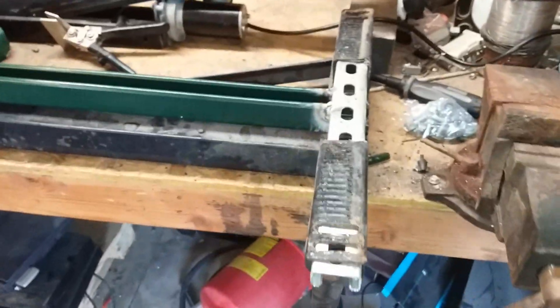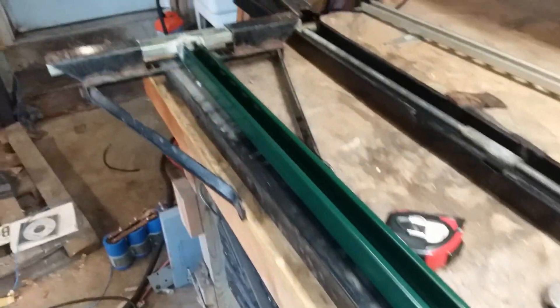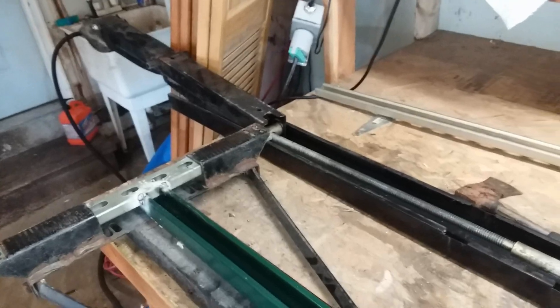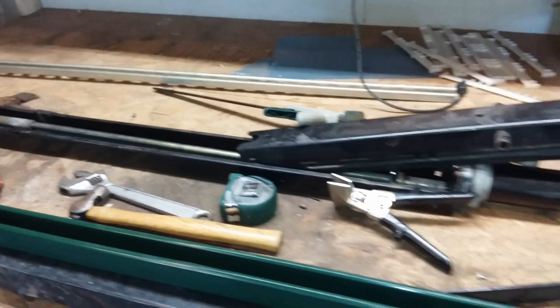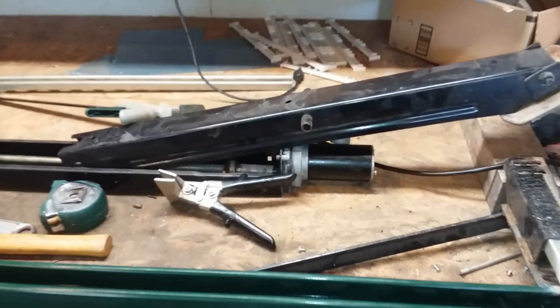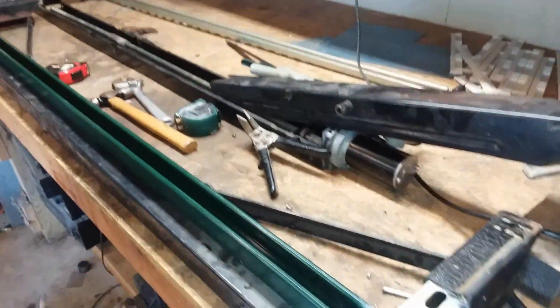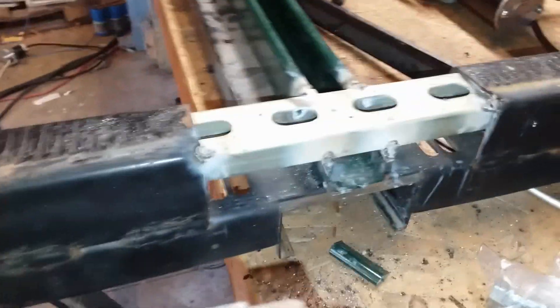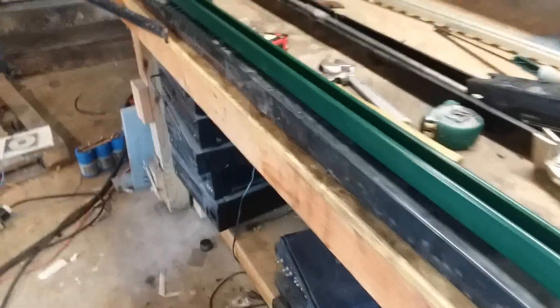This is the upgrade I'm doing using some unistrut. I placed the unistrut across the slide because what actually happens is these stabilizer legs slide back and forth — that's how they auto level themselves. They're not really meant to bear the weight of the trailer, and that's kind of what happened. So by sliding these out of the track — there's the track right here — I was able to pound all this out and straighten it.